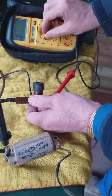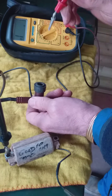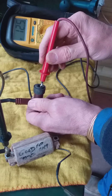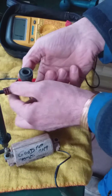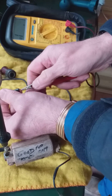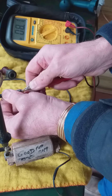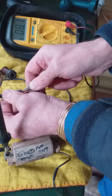Put this on 200k — so it's on 200k ohms. Pop this in here now, I get a reading of 12.5, which is a little bit high. But if I take this off and do a reading now, I'm going to get a proper reading of 8.1. So there's a difference there — just over 4 ohms of difference by using the suppressor cap.